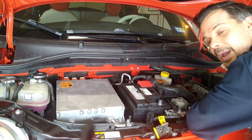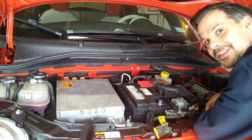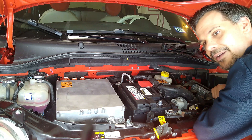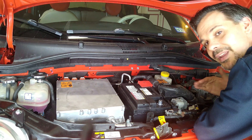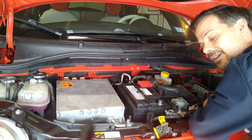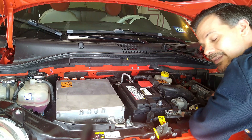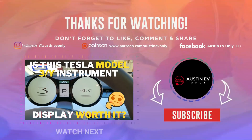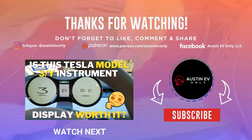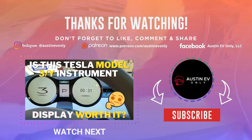The drawback of a lithium-ion battery is that it doesn't charge well under freezing temperatures — in fact, it probably doesn't accept charge at all. That's why you have a battery heater to keep the battery temperature above certain values so that it can accept the charge. These 12-volt batteries don't have their own separate heater, so if you replace it with a lithium-ion battery, be careful on cold days — you might not be getting charged back up. Well, that's all for today, folks. If you found this video helpful, please smash that like button, and more importantly please subscribe — that's how we make more videos. Until next time, this is Austin EV Only.